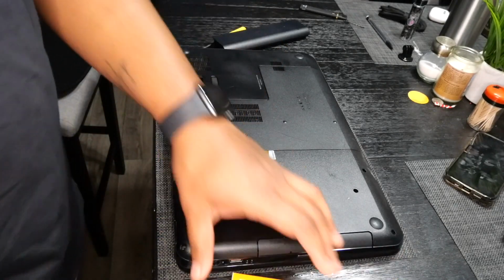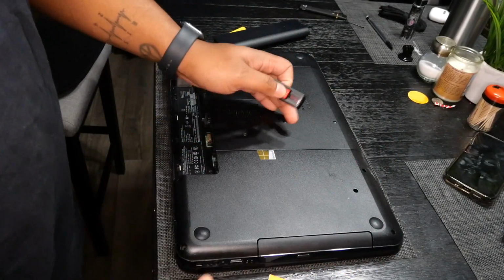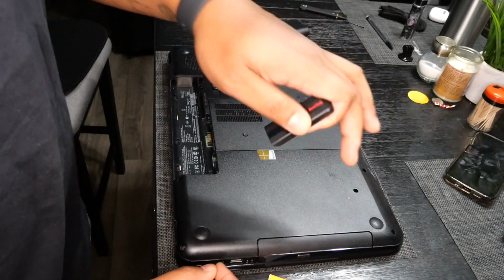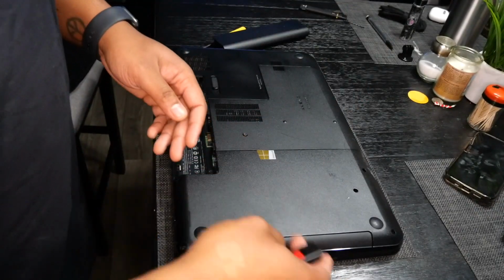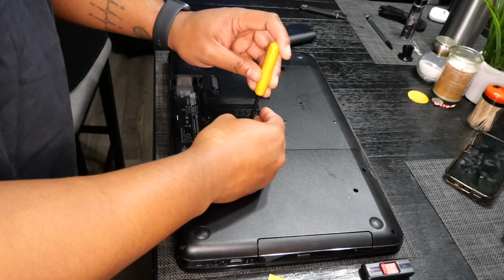By the way, if you do convert your computer to SSD, or if you want to do a clean install of Windows, you're going to need a copy of Windows. I'm going to leave all that stuff linked in the description below, but you're going to need an 8GB flash drive. And for Windows, all you have to do is download the Windows utility, and that'll automatically create a bootable USB drive with Windows 11 on there.